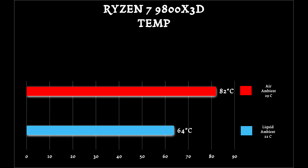Next we take a look at the CPU thermals. Initially, the liquid cooler kind of blew the air cooler out of the park. This was a 47GB 4K ProRes video that I processed in Handbrake — I wanted to see what the CPU temperatures looked like at 100% usage. We see it goes to 82°C average with the air cooler, however it was only 64°C with the liquid cooler.